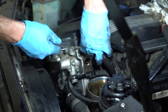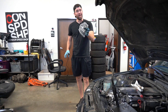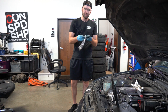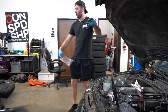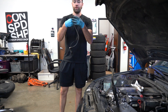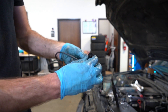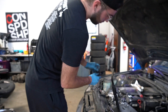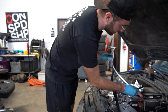As I'm pulling that cable I'm noting where it's coming from so I can feed the new one in the same way. I just got the old one out. Here's the old one — going to toss that aside. The new one does come with an o-ring already, which is super nice. I ordered a couple extras but that's okay. Always want to make sure you replace the same parts. I'm going to lube up the o-ring just a little bit with some oil, then fish that line through just where I pulled it out, plop it back in, and reach my hand down there to connect it back up. Intake side is officially done.